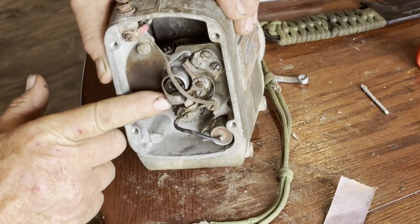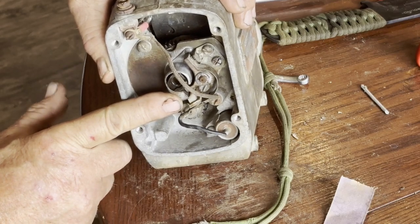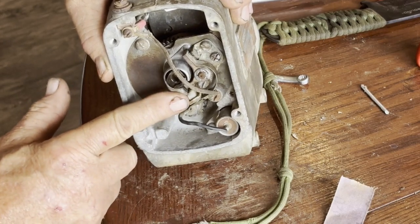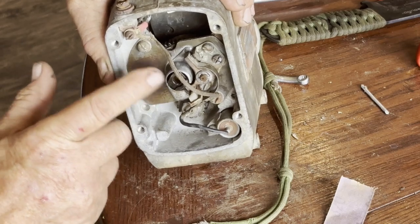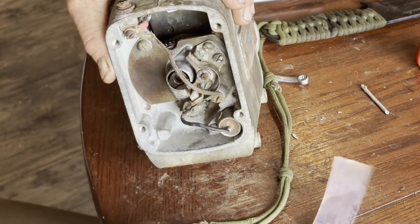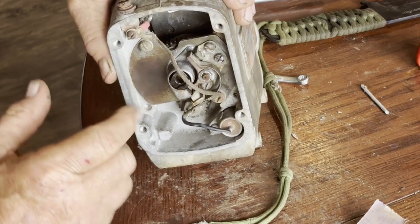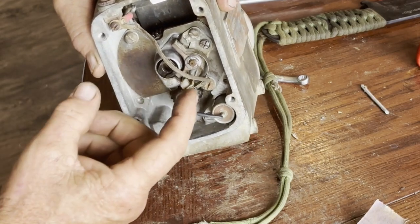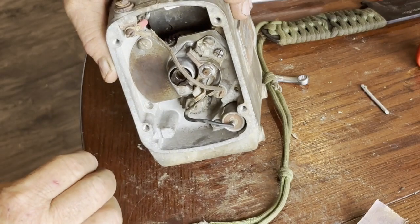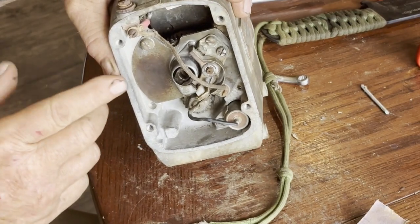There's a little shroud here, and inside is a felt, which is pretty hard and dehydrated. So I just kind of worked a little grease into it. So it's gonna allow a little bit of lubrication on that cam, and I polished it off with emery cloth. It's going to allow some lubrication on there to function these points. Also cleaned off the points with a small metal file,